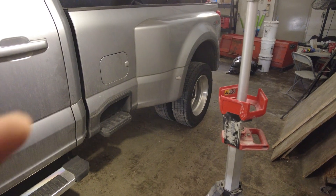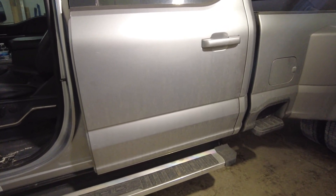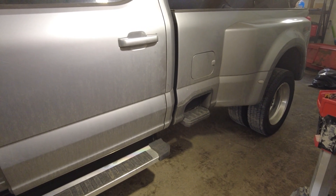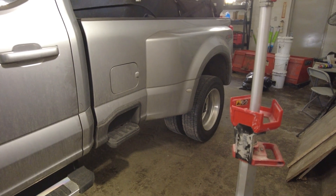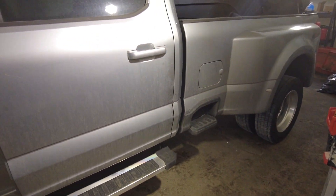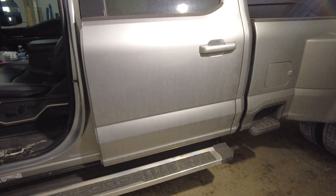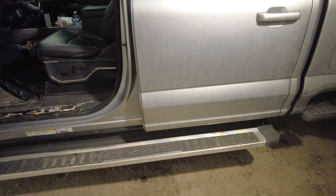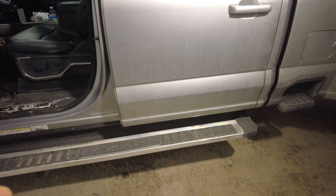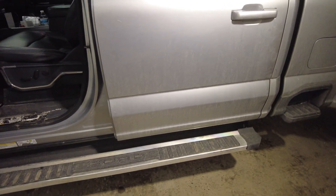It will corrode steel though. With the Fords, everything's powder-coated real nice underneath and painted well. This is the second year of salting, and if you look underneath the truck, the powder coat on the frame is holding up good. We try to rinse the truck off every time we service our properties, but it will eventually rust out in areas that can't be washed well. It'll take maybe 15 years before you start having vehicles with compromised frames.